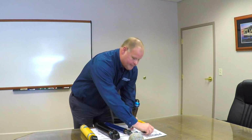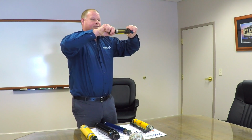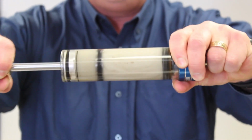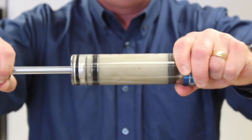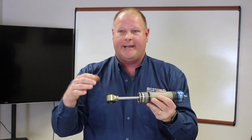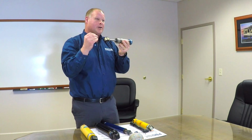If you do not have pressure on the shock absorber, that shock absorber will start to create a foam. Just like with a pop, as soon as you open the can, it foams up. If you do not have pressure on the shock absorber, it will foam up as well. With a twin tube design, you cannot put pressure on the shock. If there is gas involved, they charge it.